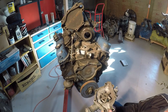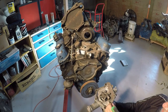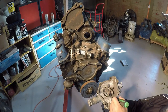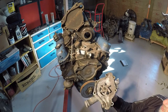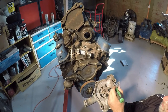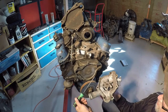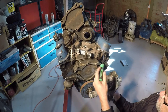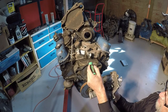and the water pump starts to turn, and it throws the water outward, and in the process of doing that, creates a higher pressure out here than down inside here, which is what causes the water to move. As it gets thrown out and around here, it comes out to the far ends, goes all the way to the end of the block. In the process, there's holes in the block that go through the head. The coolant goes up through the head, comes out of the head into the intake manifold and to the thermostat.